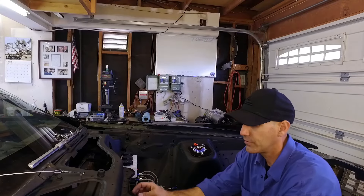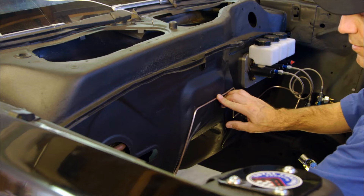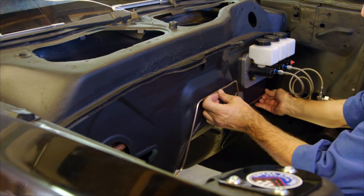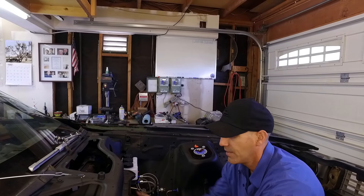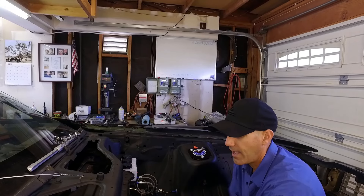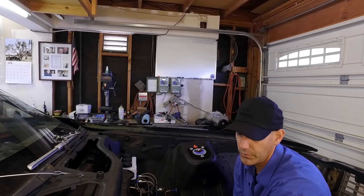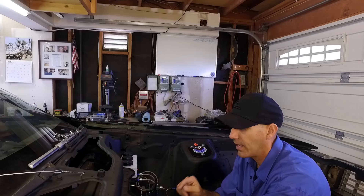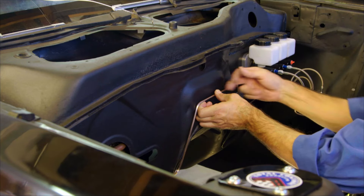That will go like that, mounting right here to the bottom of my T. There's always room for final tweaking, but the initial position is pretty good — follows contours, looks on purpose, really handsome and trick. Now I'm going to attach this in three spots: one right here in the middle, one on each end, to keep everything in place and reduce vibration. I'm going to show you how to use rivnuts instead of sheet metal screws through your firewall for a higher quality look.